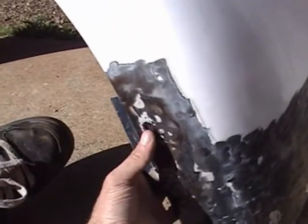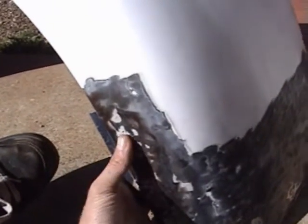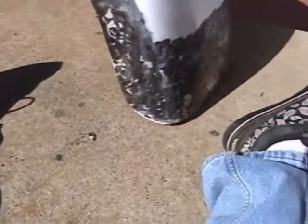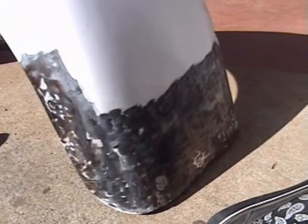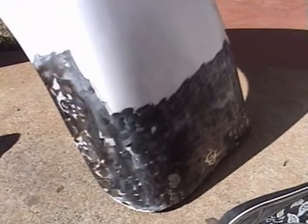So I'm gonna keep working on this. For some of these back fills, I'm taking a piece of aluminum, putting it on the back — or the front, whichever side works better — clamping it down, then welding it, taking it off, and doing some grinding. It's a good little tip. At least this way, after I use body filler just to cover up some of the dent marks, the magnet will stick to it, whereas before it wouldn't. This is way better in terms of body work than just filling a dent with bondo and charging you a whole bunch of money. So if you want to save money and do it the right way, this is the way to do it.